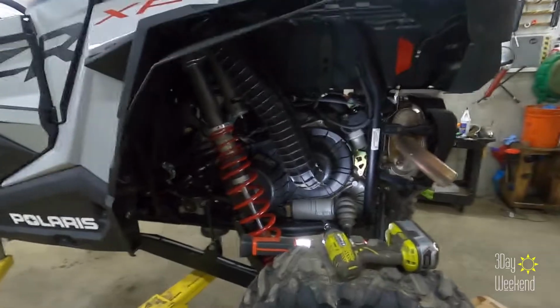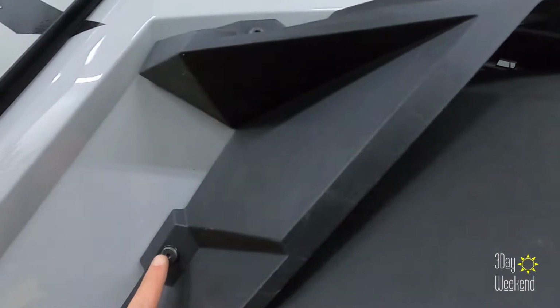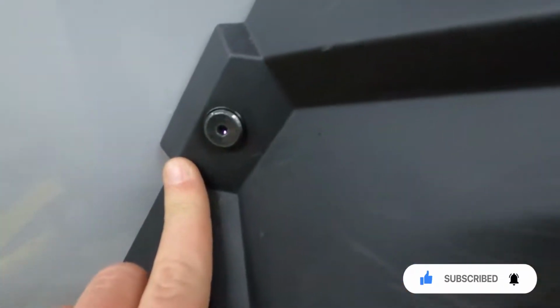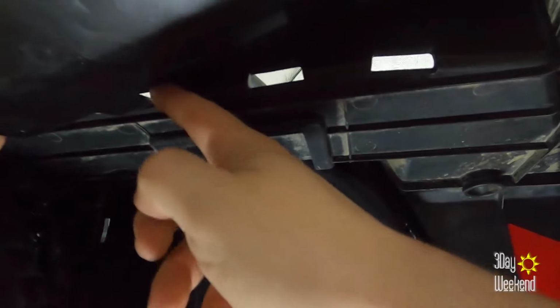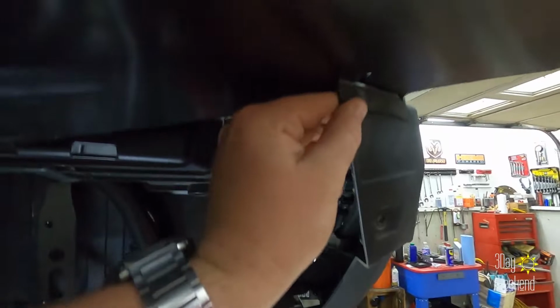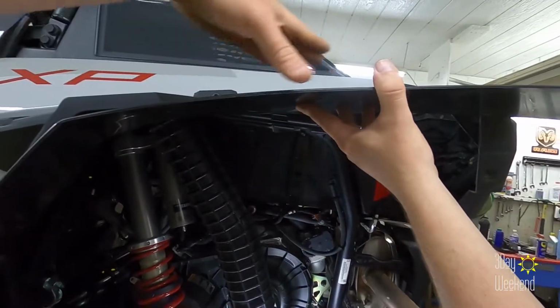What are they saying is supposed to go there? I think the L bracket's for the other fender. For the Max? Okay. So we put one of the long inch and a quarter bolts through here. And then it goes over at the back. Tighten that with a nut. Then these tabs have to go in those tabs. These 3. Yep. Then take this out so that you slide that down because it's going to wedge in between. And once we get that lined up, we'll drill these holes.